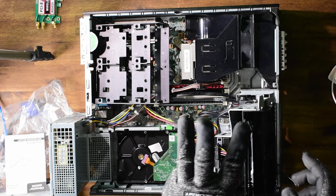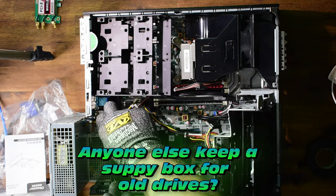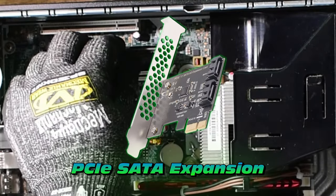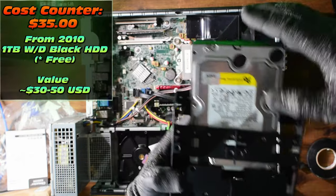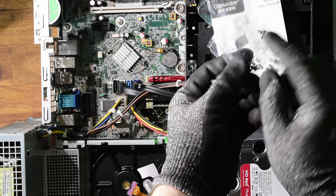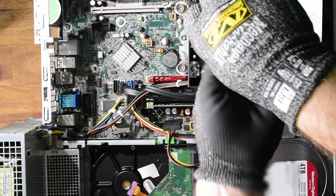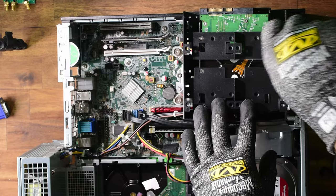For me I'm just going to keep it simple — three spinners and maybe a couple of SSDs from my supply box. A little bit of insulation tape will keep those wires out of the way for cable management. We have four SATA ports on the motherboard, so we can only fit four drives unless we get PCIe expansion. Here's a 1TB candidate I pulled from another machine. For the 3.5-inch screws, I'm going for four to secure it nice and tight.